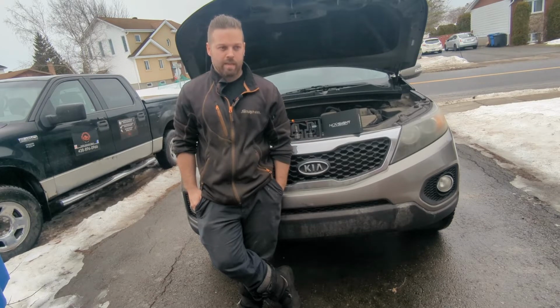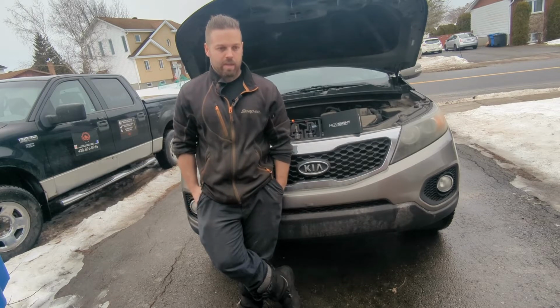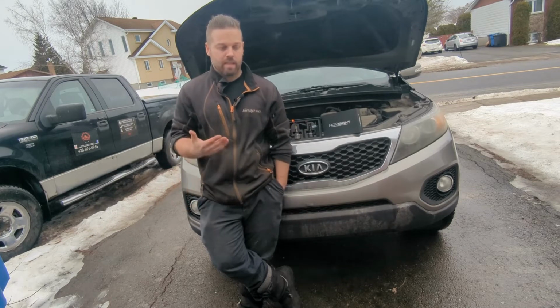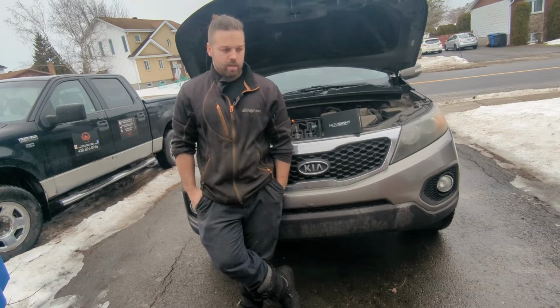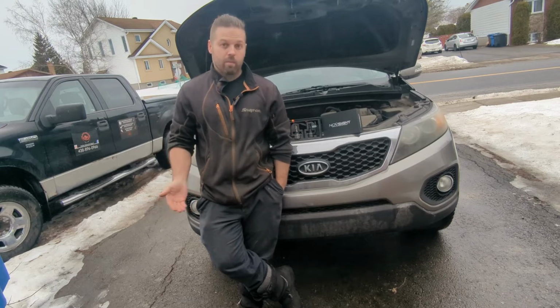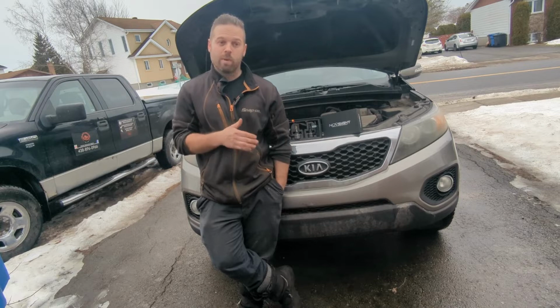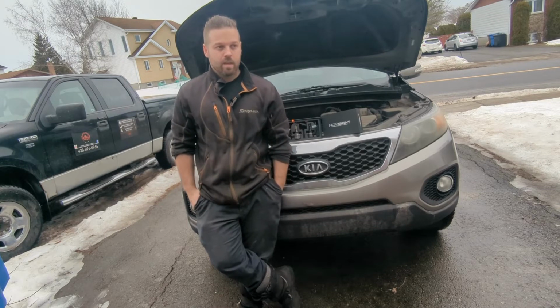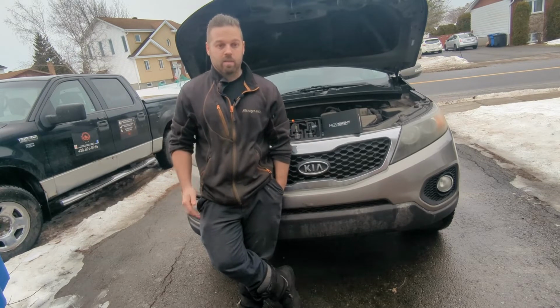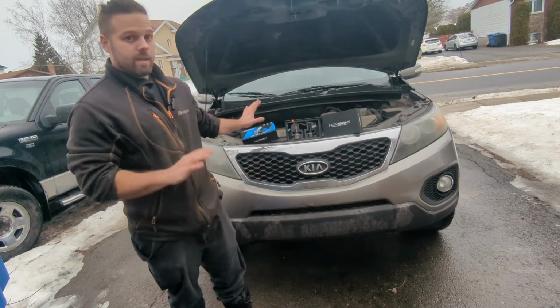Important to remember that there are little caps that are going to be on the back of the lights. Some people like to just take the ballast and everything and shove it inside of the headlamp assembly. I might try that, but I don't believe that's the right way to do this. We're going to install them on this vehicle and see how everything goes. If there's enough room, I might put the ballasts inside the lights. And if there's not, they're going to be hanging outside the lights just to keep them a little bit cooler.